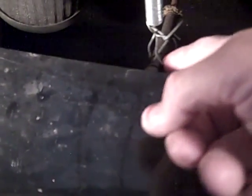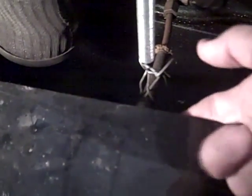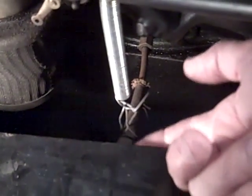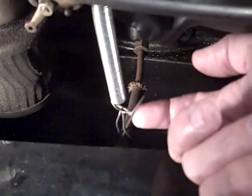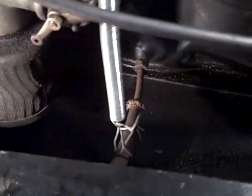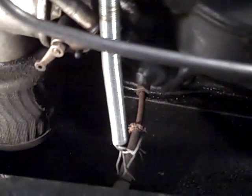On the throttle return spring — what you should do is go find a spring at a hardware store, hook it around the bottom part of your throttle, and then attach the bottom of it to a screw that's under here. I've got mine — it's not showing — but there's a screw there. You can make a little bracket and attach it to that, and if something ever happens to that spring, this will always close your throttle. Good luck.